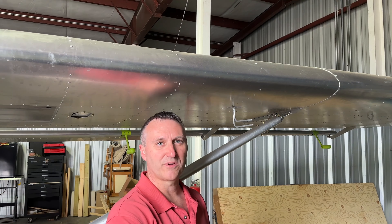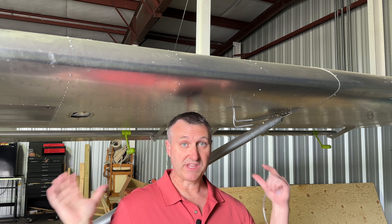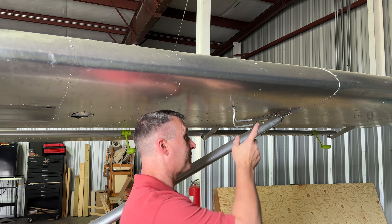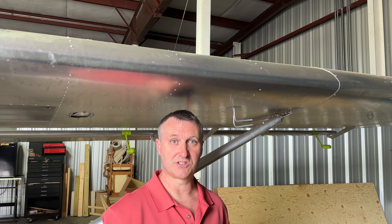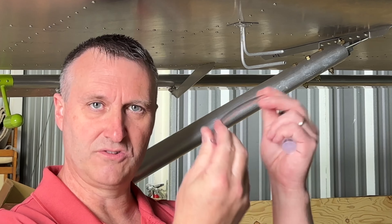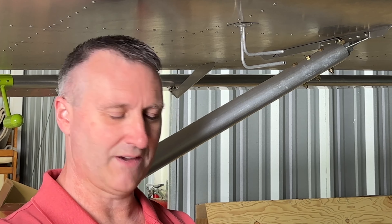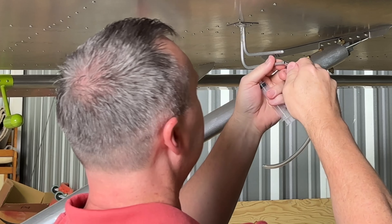I'm not sure if you remember last time — I was going to rivet this in place. I did my pitot tube here, so that's riveted and everything's plumb to my instruments. I just need to know if this is working. You can't really blow into them — I guess it damages your instruments — so I looked at Home Built Help on YouTube and they said I can use a little piece of tubing and a 12cc syringe, so we're going to hook this up and see if it works.